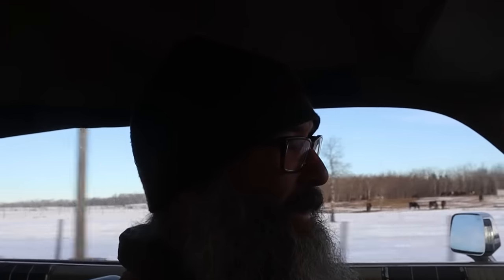Okay, it's a couple days later, and I'm headed back to the GCFCE. We did have a rare occurrence of failure the other day when we tried starting the Oldsmobile, and then noticed that the plug wires were just arcing all over the place, and we're kind of wasting our time. So Dan wants the car back inside, so I'm headed back over there today, and we'll throw some plug wires on, and then I expect that the Oldsmobile will probably fire right up.